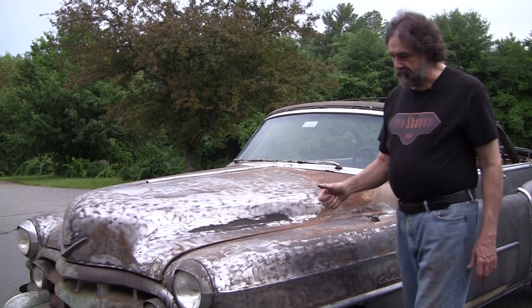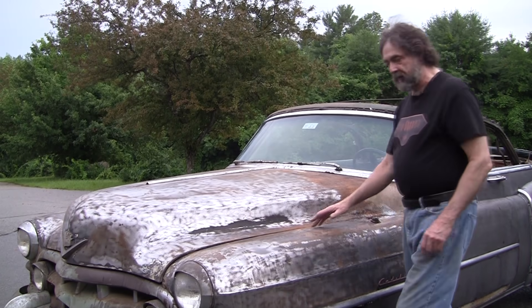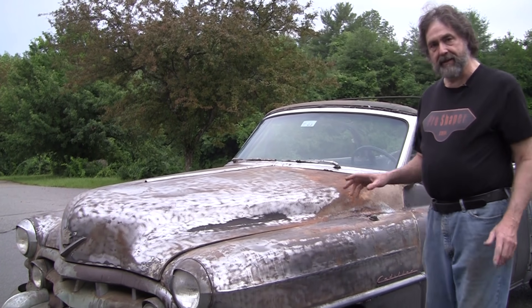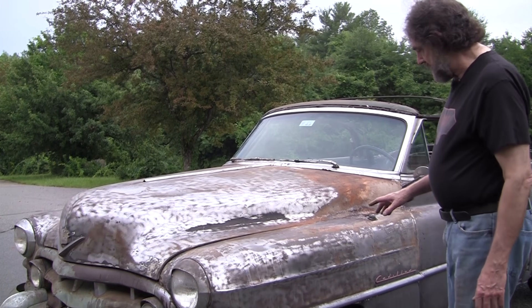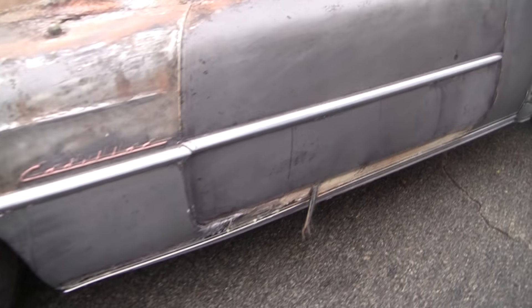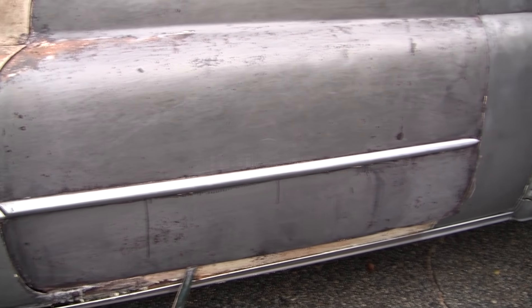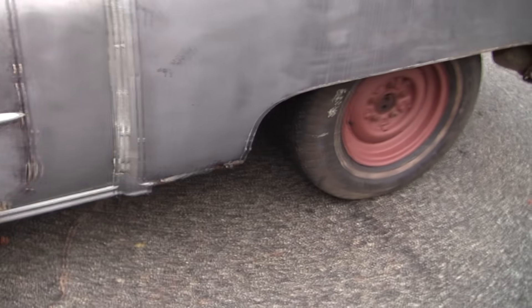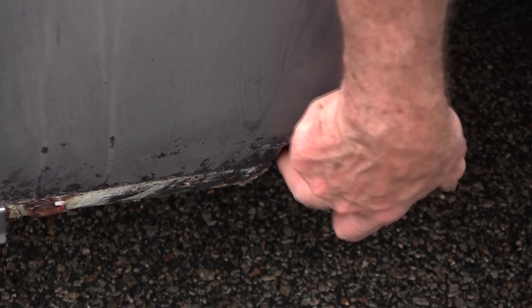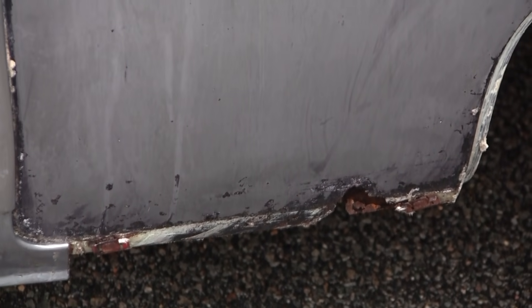We'll probably do the phosphoric acid with the sprayer again, and we'll be able to make a record of all those little small parking lot dents that have to be fixed. There are a couple on this fender. The doors have some creasing at the bottom; the other one seems to be worse than this one. This one's got a little punch right here. The bottoms of the doors aren't rotted. This is actually the worst rot spot on the entire car, other than the raccoon damage over there — there's a stainless polished molding all along the bottom, and it trapped road junk in here, and it rusted right through. So you're going to need a patch right there.